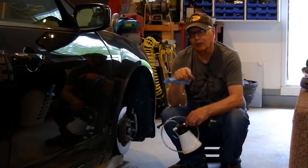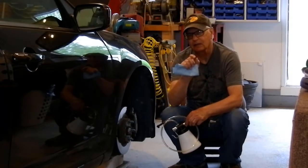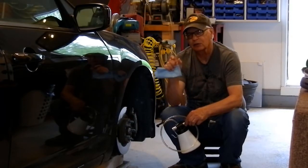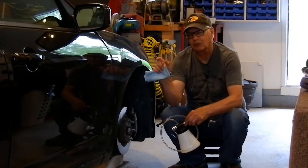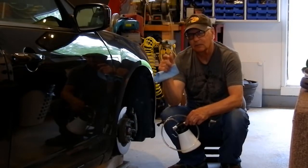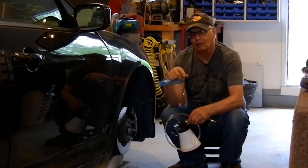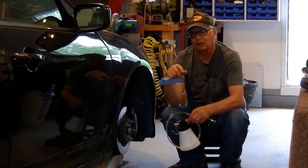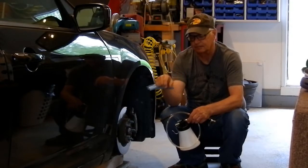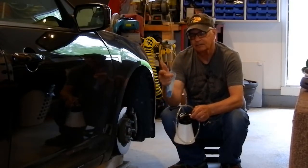When you do a brake bleed, you're opening the bleeder valve, and that allows your buddy to push the brake pedal much further, and the piston will advance into that dirty part of the master cylinder, and the cup will get damaged. So after a brake job, the first thing you know, shortly thereafter, you've got a master cylinder problem. So I've adopted the vacuum method.